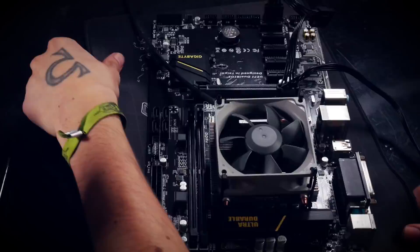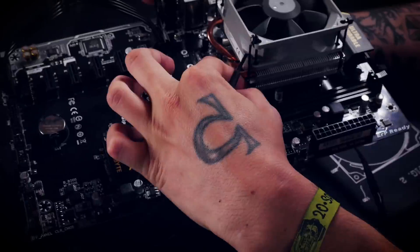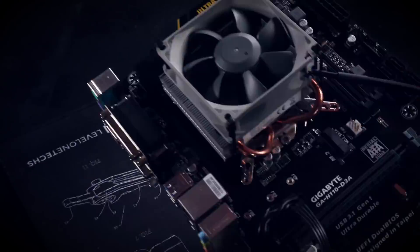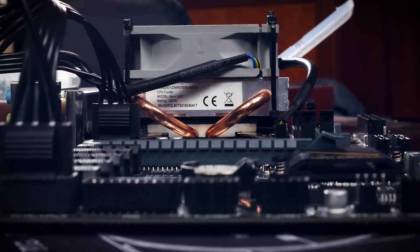So that's the setup: i5 with low-profile cooler with the Noctua Redux fan. Let's add a pea-sized drop of thermal paste — I'm using my Thermal Grizzly paste again like you already saw — and after that just some wiggling. Air coolers can often be a pain to mount, but we got it. What we have now is looking much, much better than the original Intel cooler, even though we'll never see it again under the cards.